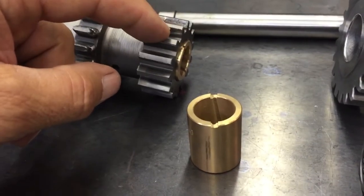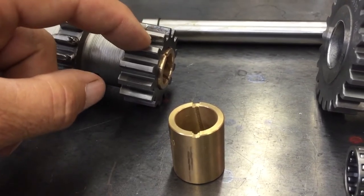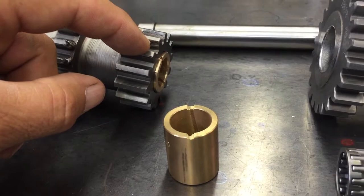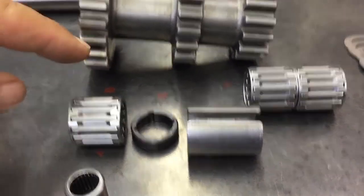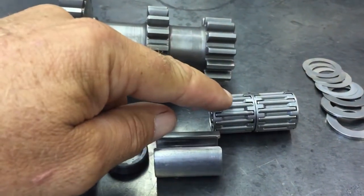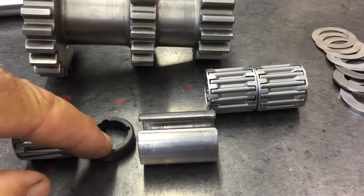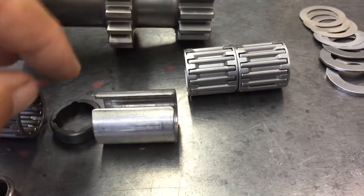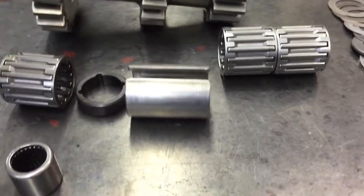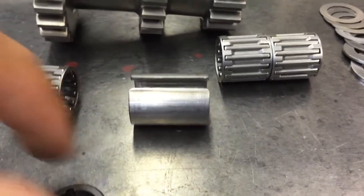Even when you're changing your oil on stock bikes, you'll see a constant bronze color coming out — it's actually this end of the bearing that's just wearing away. The setup here is one roller bearing on this end; the output end takes two. There's a spacer that goes on this end, or if you've got a stock-type gear setup, this is the spacer used for that — so you'll use one or the other. The way to get the end clearance is with these thrust washers. It comes with a selection of thrust washers, so no matter what setup you've got, you'll be able to accomplish your end float.